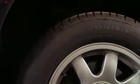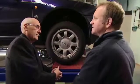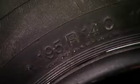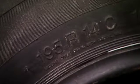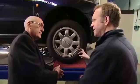65 would be a low-profile tyre. So what would be the aspect ratio of a standard tyre? Well, a standard tyre — if there's nothing marked on the sidewall — we'd assume that to have a ratio of 82%, and for a car, that is almost the same as an 80% ratio. These can be mixed across the same axle, as they're almost identical in size.